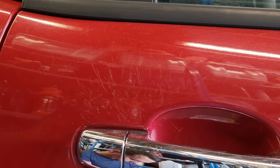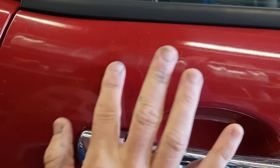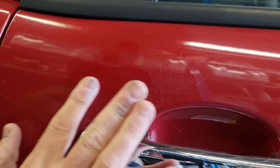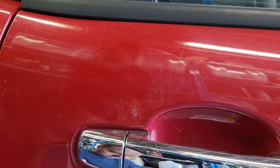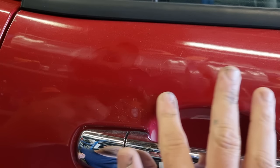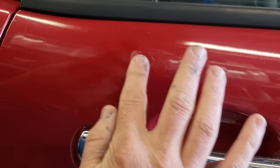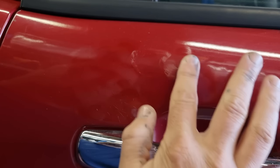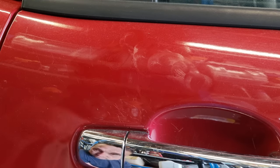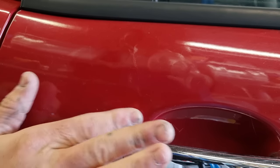We've just rubbed that into the scratch. The damage is on the front and the rear door, so you'll be seeing both panels. The rear door has the same kind of scratches — probably more on the rear door — and the front door has a couple of slightly deeper ones. It's solvent paint, pretty much neat, not thinned down. I'm applying it with my finger. It might be advisable to wear gloves, but I find it works slightly better on a bare finger. I'm applying a very small amount — a tiny little drop on my finger.